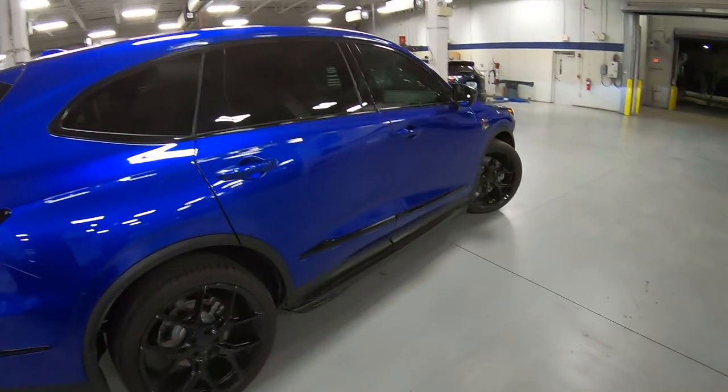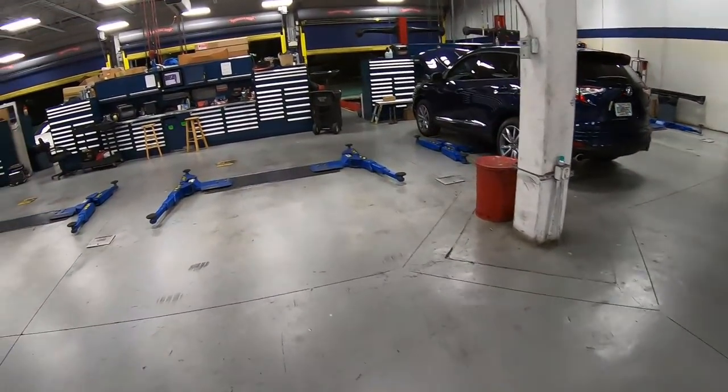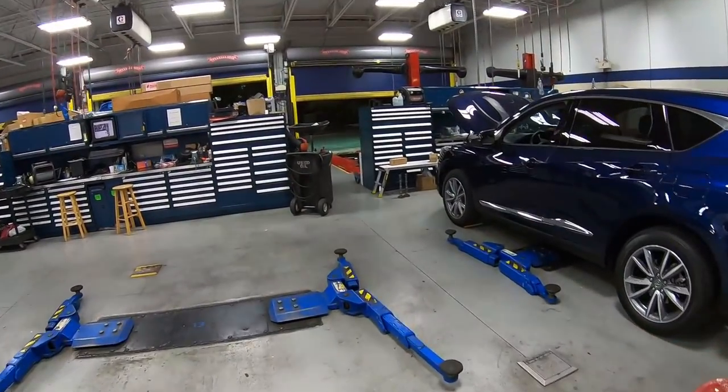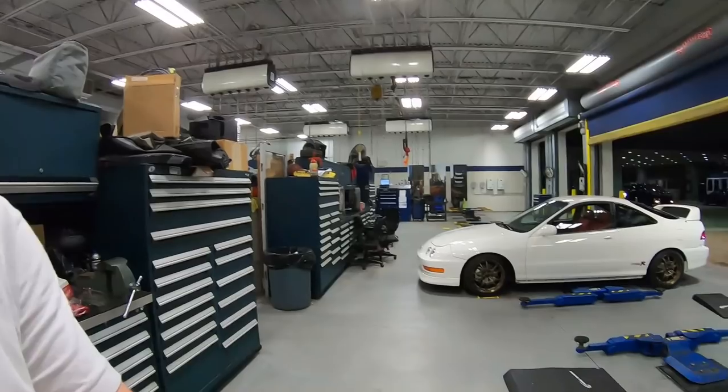I'm going to take the car over to the other side of the shop now that it's been disassembled. This car is going to be worked on in pieces. Other than a door and a fender blend, which we'll get to later, we're just going to bring the car in and let it sit for a moment. Then I'm going to show you what to do to prepare brand new parts — how to prepare OEM parts and some of the techniques that I use that really help.